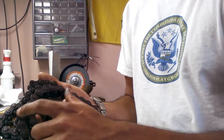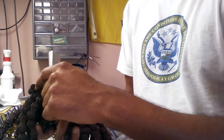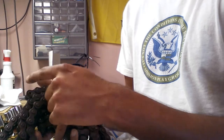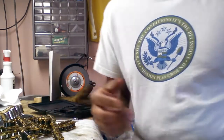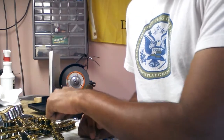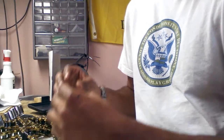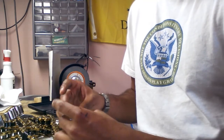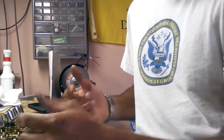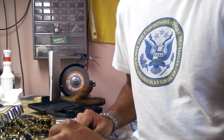So I counted down on this and I got 45 for the outside links. I added 1 for that master link — 46. Multiply that by 2, you get 92. So then on the new chain, I would just count the outside links again until I got to 45 and then I'd cut after that so I'd have 2 inside pieces left. Normally both ends already have the inside links on so then you're putting down the master link, but you just count it all the same.